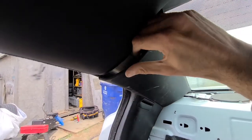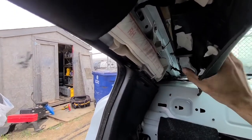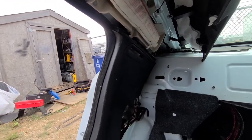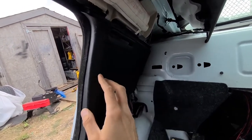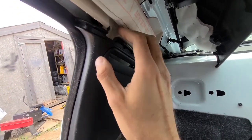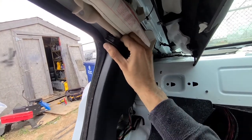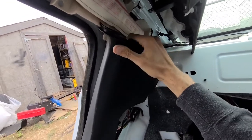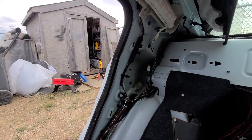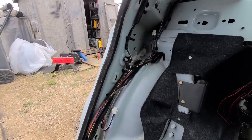The upper part you just want to pull it off because it doesn't have to be removed all the way — this will do fine. Now you have this part which has to be completely removed because the seatbelt will actually have to pass through this hole here. So you want to completely remove this for now — just pull it and work yourself to get all the pins out and removed. Now you will have access to all the mounting points.